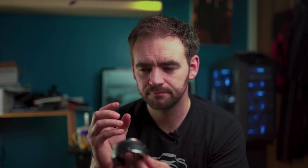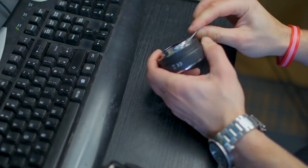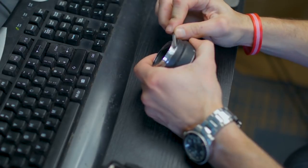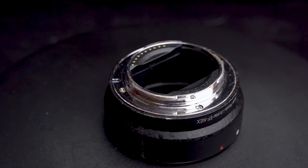However, before I could even get the Canon 70-200 mounted onto the camera, I ran into a problem because it wouldn't mount. It would just about squeeze onto my NEX5 body, though very, very tight. I figured it was something to do with the bayonet mount on the back not being quite the right size. So I spent about half an hour taking a file to various different bits of the teeth, and eventually got it to mount onto the camera okay.